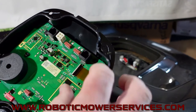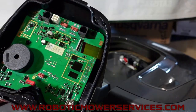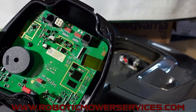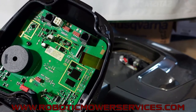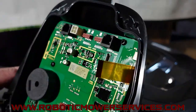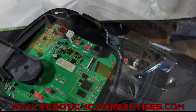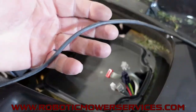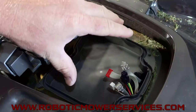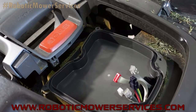Be very careful — gently pull back on that ribbon cable and get it out of the way. Now you're ready to take your screws out; they are Torx bits, smaller than T20. If you don't have the smaller Torx bit, they also have slots so you can use a flat-head screwdriver. Now I'm going to put the new chassis seal around the area where the top assembly goes — pretty straightforward if you've seen our other videos on replacing a chassis seal.